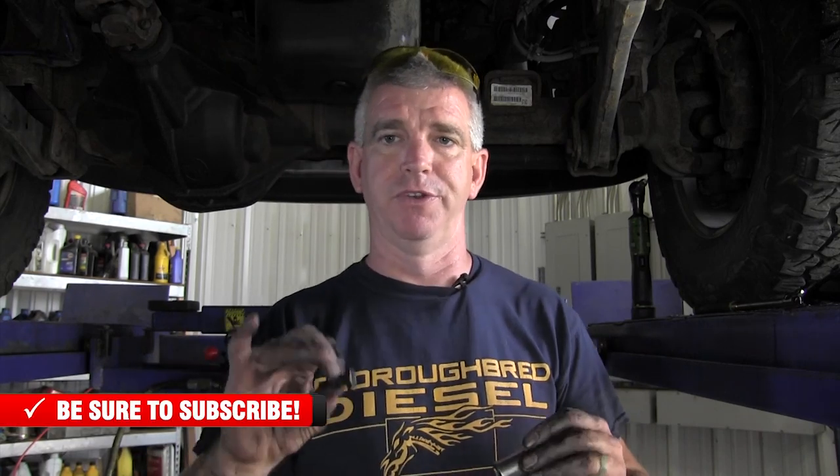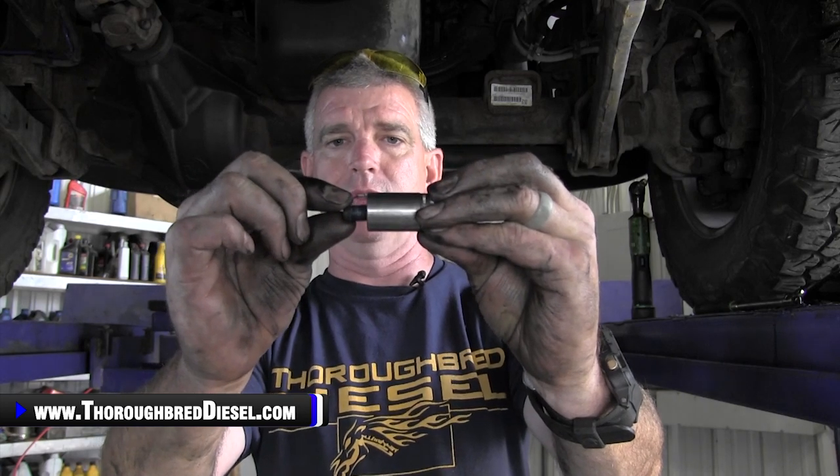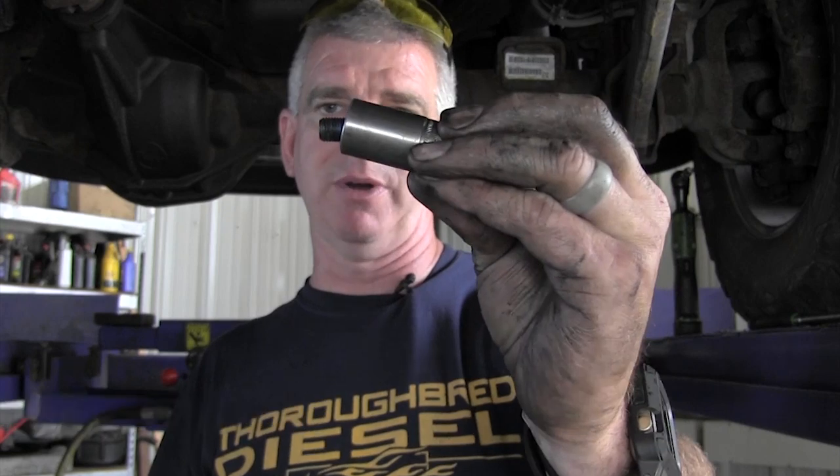I want to talk about your torque converter bolts. On a 47 and 48 RE, there are six torque converter bolts with a 15 metric head. Your torque converter bolts are pretty shallow — not very long at all. When you have a ratchet in there loosening those bolts, if you use a deep well or mid depth socket, the bolt will go inside the socket as you loosen it. That way when you go to pull the bolt out, you don't have to worry about it falling down in there. Try not to use shallow wells — use a deep well because it'll keep you from dropping a torque converter bolt. If you drop one, it's not the end of the world since the transmission is coming out anyway.